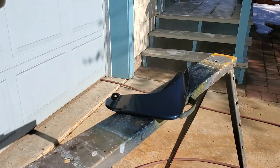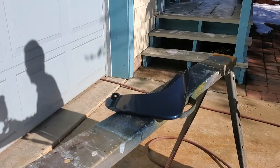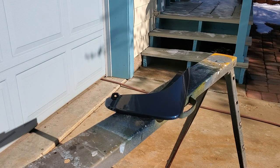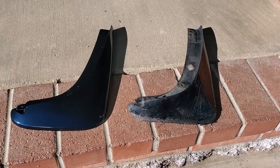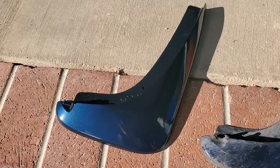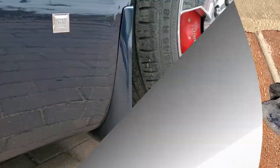You're going to need a minimum of two coats — I actually did three. The first coat should be light; it should be a tack coat. The other two coats were much more wet, and the slow urethane reducer caused it to flow out very well. On the day this was painted, it was only about 50 degrees. You can see the finished one is super smooth compared to the old one — there is no color sanding done to that; that is the way it was shot. Remember, Deltron Clear at normal mixing ratio plus one-third slow urethane reducer is necessary to get that result on your finished part.